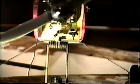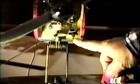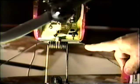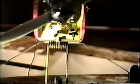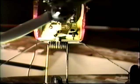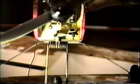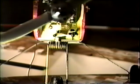Can't see the whole nose wheel, but anyway, see this thing here. This here. In the past, I've always had problems with the linkage coming loose, and you know, nose wheels laying down on me. So I thought if I was going to have a nose wheel this time, I would try to make it as strong as I could.